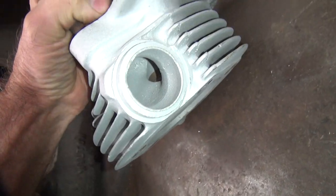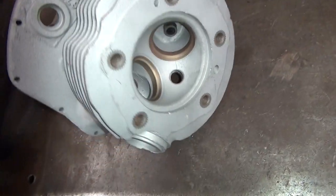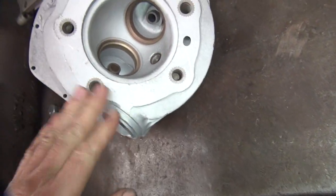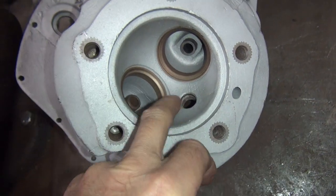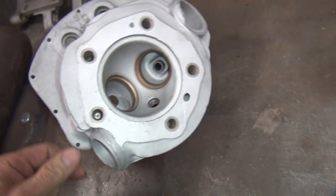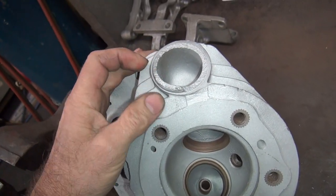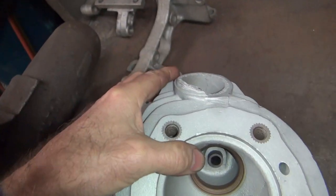All these could be helicoiled, so not going to weld any of them — a lot less work. I am going to fill the hole up in here and over here, and probably touch up these fins too — all these cuts in the fins and nicks. I'll clean them up. I also need to do the nipple over here where the lip has been broken off. Other than that, this is a pretty nice head. Got a little fin to do there too. Combustion chamber is pretty good, very light cracks — nothing special. The guide holes are all good.